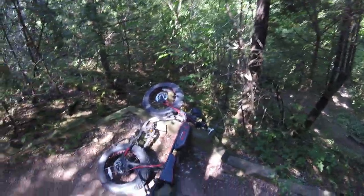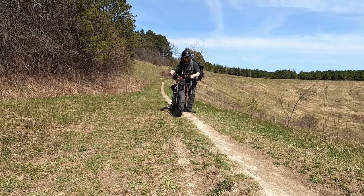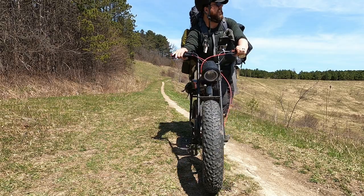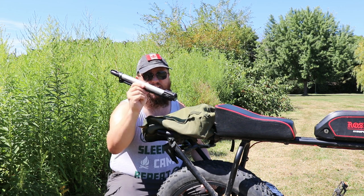I don't really use it too much on trips as I try to focus more on skateboard-style electric rideables. On one of my last trips I let the brakes get too loose and going down a downhill section I almost got seriously hurt — actually the closest I've come to getting seriously hurt on any of my adventures. I learned my lesson: the brakes are now properly tightened. I was also having an issue with flat tires, but backing the pressure off to five PSI less than the max rated pressure seems to have fixed that. I now carry a set of spare inner tubes and a portable bike pump in case I get a flat out on trail.